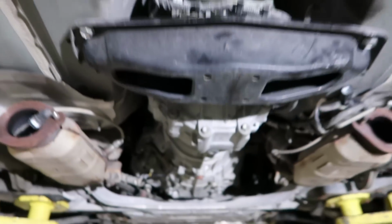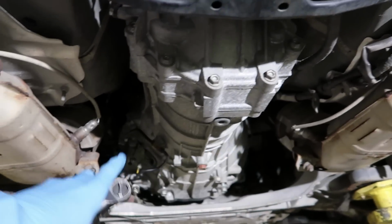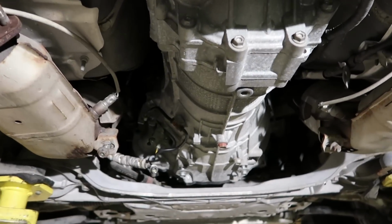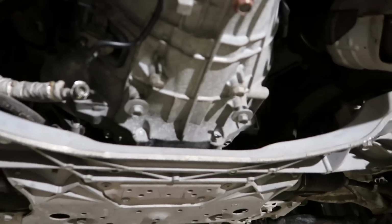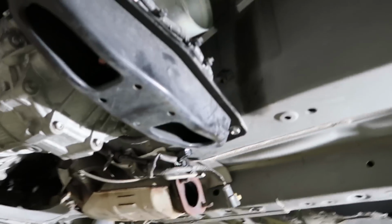Welcome to today's vlog. Let's continue the video that we ended yesterday. As you can see, I have the transmission hydraulic jack right here. So we're gonna continue on loosening up the bolts that were remaining, and let me show you. Removed all the bolts around the transmission. There's two at the very top, as I mentioned last video. The only thing that's left is I gotta remove this cap right here to get to these two bolts right here and remove this bracket.